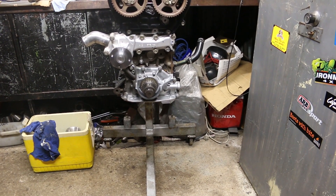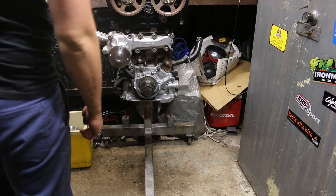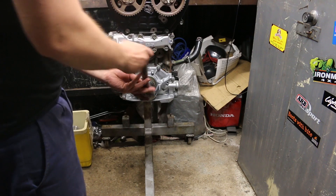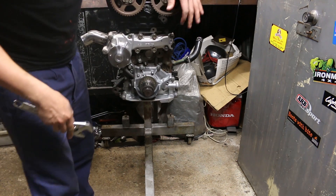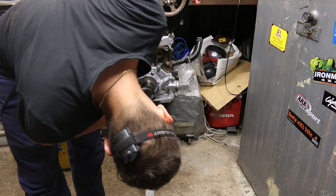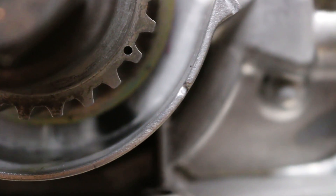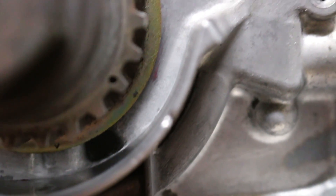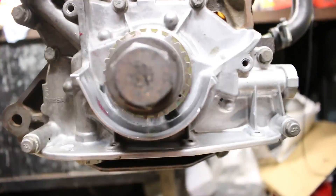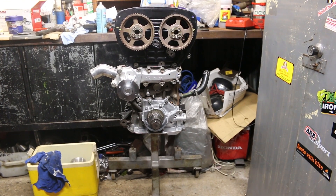Then from there we can put the belt on after we put the tensioners and pulleys on — there's only two, here and here. Now that we've got everything lined up, we're going to put on our timing belt. The timing belt I'm using is a Gates Racing timing belt — apparently their claim is that it's three times as strong as the OEM belt. What we're going to do is put about half of the belt on at the bottom, make sure the teeth are all in their grooves, slide it up. Because of direction and rotation, we want this side of the motor to be the tightest, so we need to make sure we can adjust this later. We need to make sure we get the belt fairly tight here and then just trace it around, trying to keep half the belt off to help get the belt on in the next step.